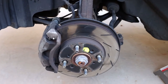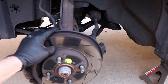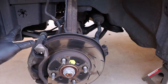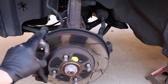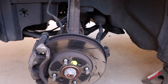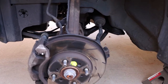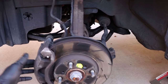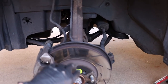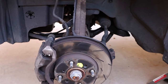Some of you may have noticed in my last video on this car that these brakes are not standard. These are EBC USR rotors and red stuff pads. I went with these because I looked into getting factory pads and rotors, and the price to do that was almost twice as much as going with this kit. I think I spent about $230 getting the pads and rotor kit for the front. I'm still looking to do the rear. But today all we're going to be replacing is the pads — the rotors are still good, still got the slots in them. Because these are slotted rotors, I can't have them turned down; no one will touch them. But I can put new pads on and still go a little bit longer.